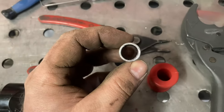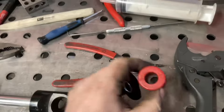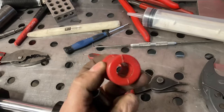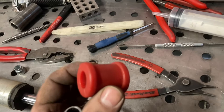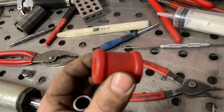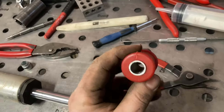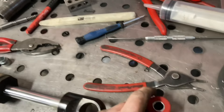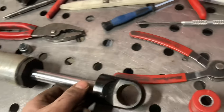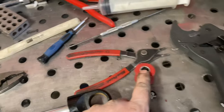I had to make up some sleeves because all the mounting points — top, bottom, front and rear — they're all set up for half-inch bolts, but these bushings have a 5/8-inch ID. A lot of older rigs will have a stud welded on the frame and these just slide right on, but if you have a bolt system you'll need to make a spacer. I greased these up a little bit when I put them all together just to prevent squeaking and keep the sleeve from rusting.